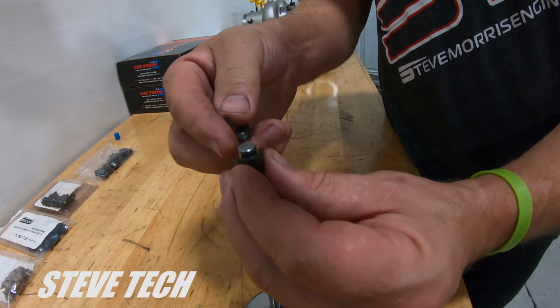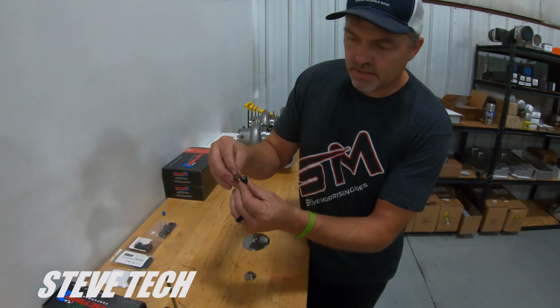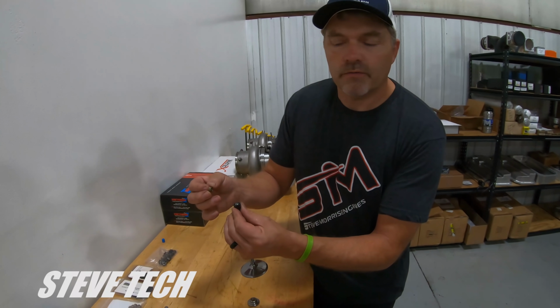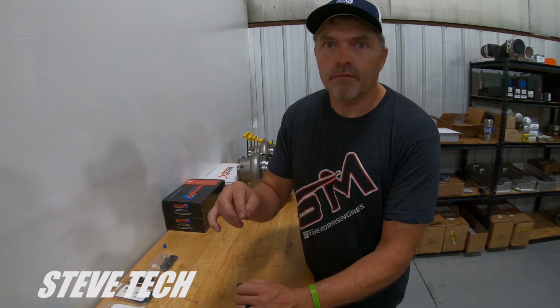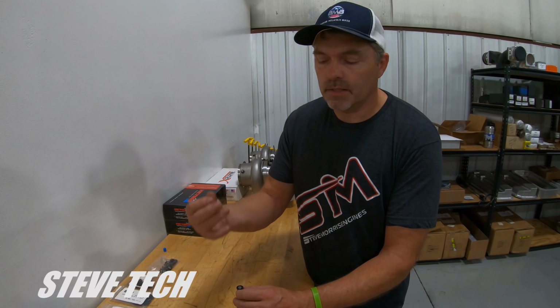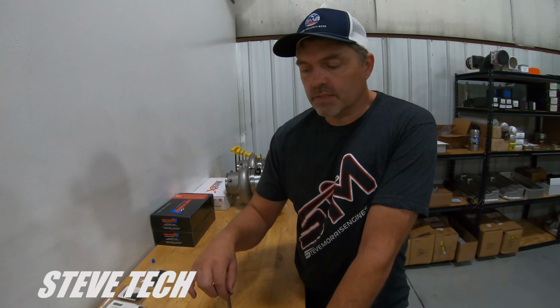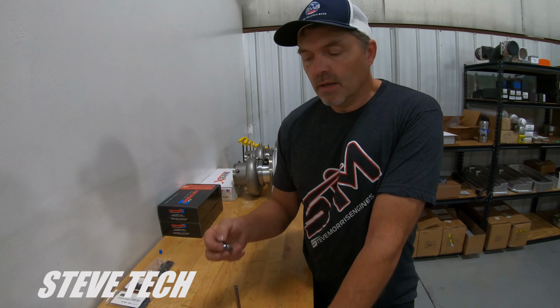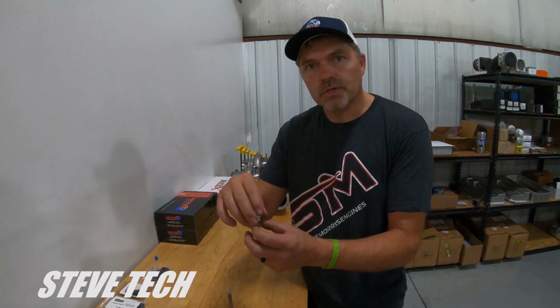So the keepers are on there super tight, they're in this radial groove, everything's cool, and then this lash cap actually sits in there and can float real lightly, but never come off, never have an issue. So you would want to do this on a non-hardened tip valve. For instance, all the stuff we do like this, my SMXs or 481Xs or Hemis, whatever it is, we do this all with this sewer lid style deal. Gives us maximum protection for the valve tip, gives us maximum strength and durability. Okay, so that's how that all holds together, fits in, and works to make that right.